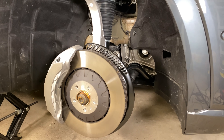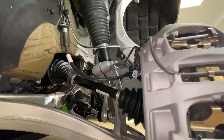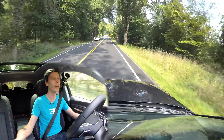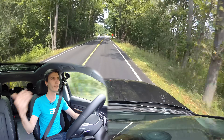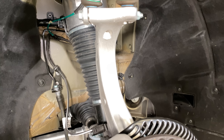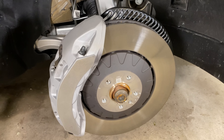A lot of people look at this system and say that's not actually brake by wire, but it is — it's what Audi calls it, it's what Corvette calls it in the C8, it's what all the companies are calling it because it is electronic control of the brakes. There are certainly varying brake by wire systems out there and eventually it probably will be more common that you don't even have a hydraulic system involved. But for now that fail-safe exists. In pretty much all driving scenarios it's never going to be used — it's only used if it fails — so probably most owners will never know what their actual brakes feel like because it's not going to fail. It's a low-risk item and if it does fail, it still works, you still slow down.